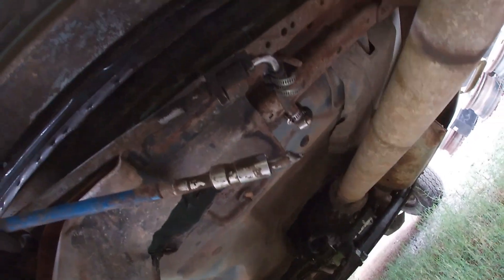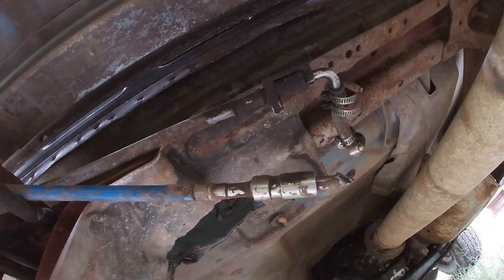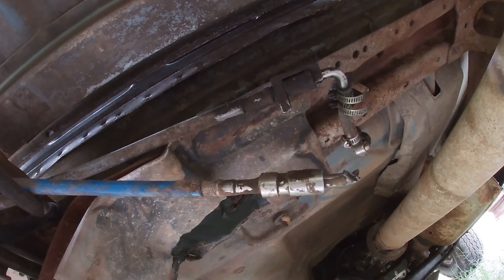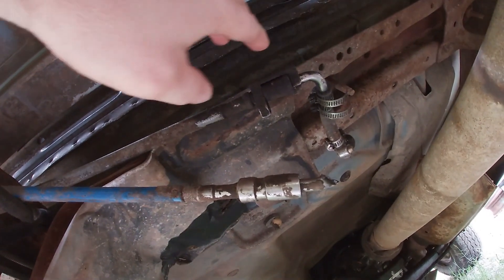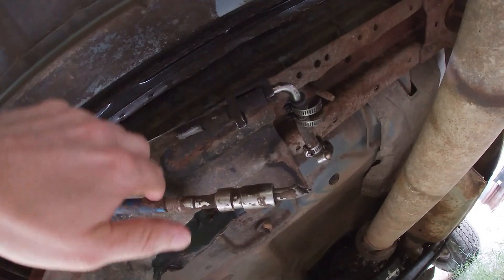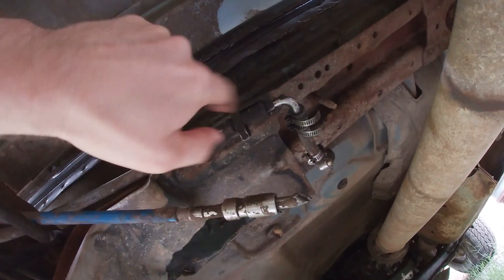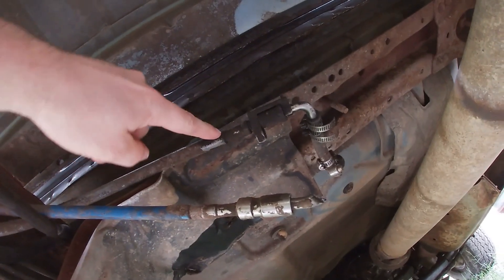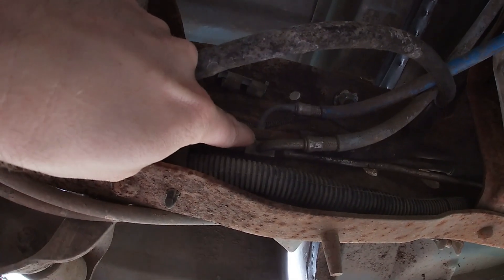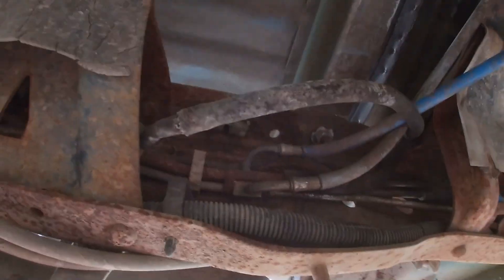So I don't like that. The good thing is the connectors are here. I was actually trying to figure out how to fix that, and Monday night I went down to Manchurch and was talking to a mechanic there. He suggested — one of the ideas I like — is to take the old fuel filter and see if I can hook that together with the same connections there, and it will block that off essentially. I'm not too worried about getting fuel flow, because this return line — the reason why it's getting gas running to it — is because if we look all the way down here it splits. So it just needs more resistance in it than it going into the tank, and it's going to want to flow that direction.